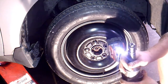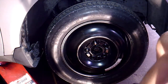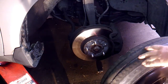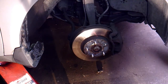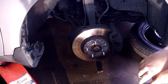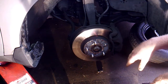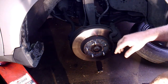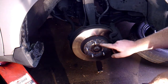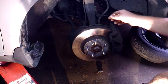You can see how much trouble that had coming off — it's cross-threaded, more than likely. So we'll pull this wheel off and replace the stud. These will just knock out. I don't remember exactly on these Hondas but I'll figure it out. You're going to take your caliper off and your brake caliper bracket, then pull the rotor off. The caliper bracket bolts should be 12 millimeter on these Hondas.